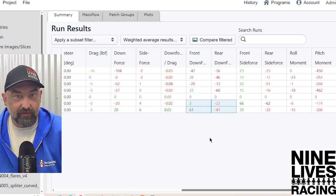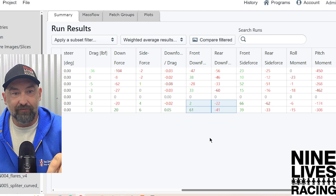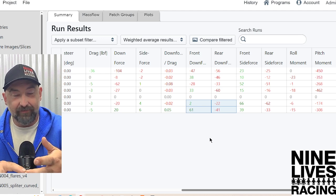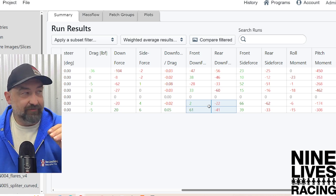More like a canard would be. I classify everything into a downforce creating device and a downforce shifting device. Wings and splitters are downforce creating devices. A downforce shifting device would be things like hood vents or canards. If you ever see a guy on the racetrack with four canards on his car, just know he hasn't done any testing — all canards do is take the balance away from the back and add a little to the front. If you have four of them stacked on a car, you just don't know what you're doing. You think you're making crazy downforce because it looks good — it doesn't. It slows you down tremendously.